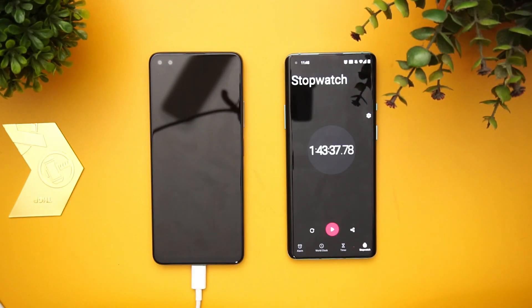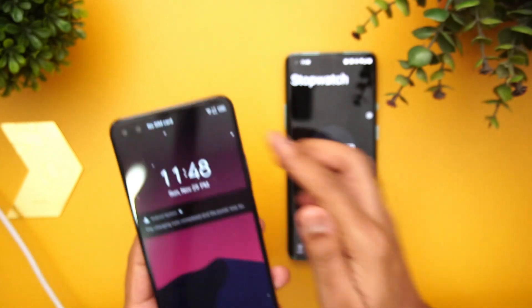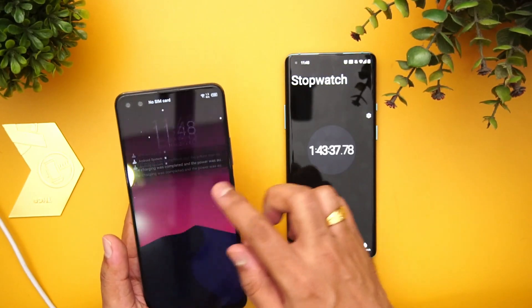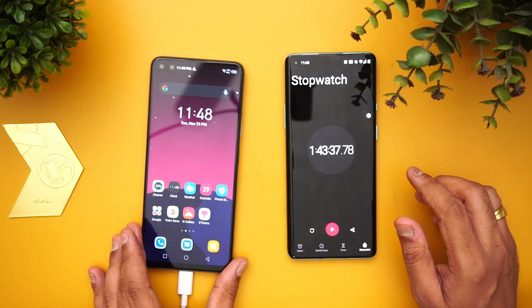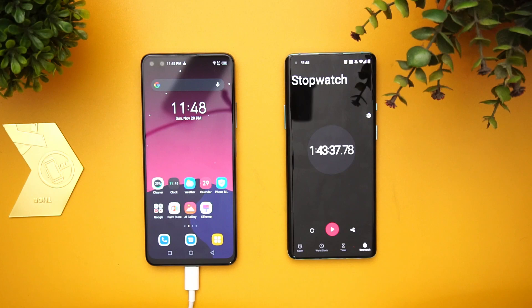The phone has now completed charging — 100% battery reached at one hour and 43 minutes. This confirms it was definitely not 33-watt charging; it was using 18 watts throughout. We're not sure which specific 33-watt charger is compatible with this device, but the Xiaomi charger took one hour 43 minutes for the 4500mAh battery — consistent with 18-watt charging. That's the charging test of the Infinix Zero 8i. Hope you enjoyed — do hit like and subscribe for more videos!